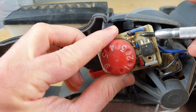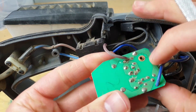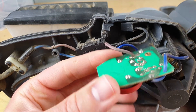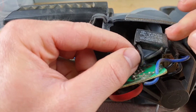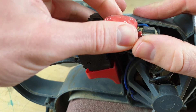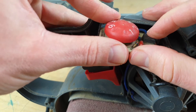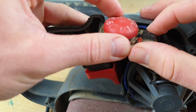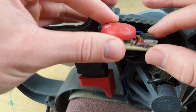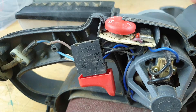When they said this died, they said it went just from working to not working — no sputtering or anything. To me that means we've got an electrical issue of some sort. I wouldn't suspect the brushes yet; more likely we're up in this circuit board somewhere. Because we're already up here, might as well pull it out and have a look. No components are black or brown, nothing funny looking on this side — so no obvious signs on the circuit board that we've got a fault.